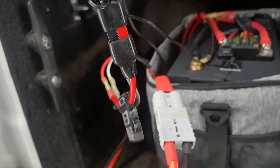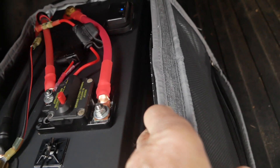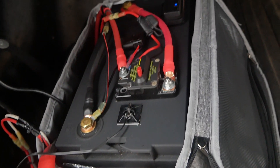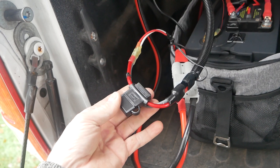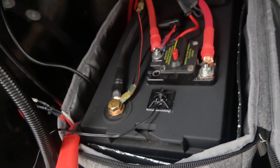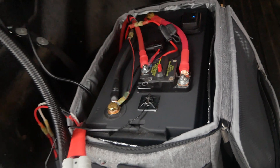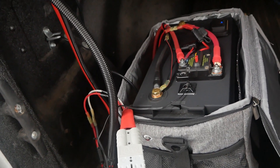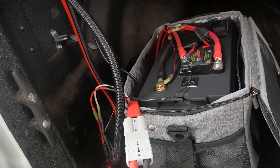What I have here is the heat pad, which is wrapped around the battery. It's a heater pad that you would normally adhere to the bottom of a water tank to keep the water from freezing in an RV — I just wrapped it around the battery. From that temperature controller inside the truck, that wire comes down here and we have a temperature probe. The way I have it set is: if the temperature of the battery itself reaches 35 degrees, the heater kicks on; once it comes up to 40 degrees, the heater kicks off. It'll just keep doing that continuously until the temperature actually comes up generally in the area.